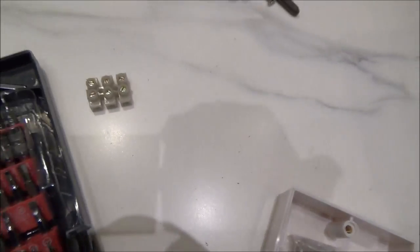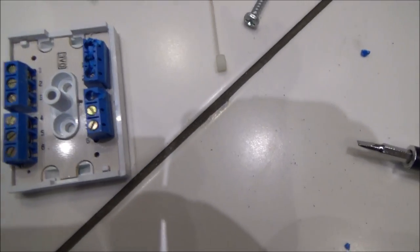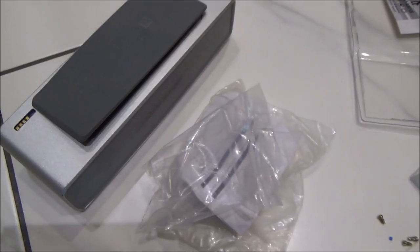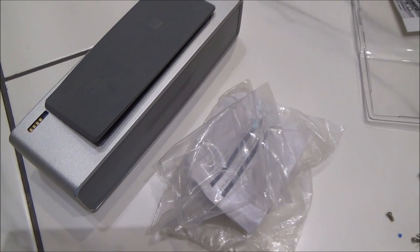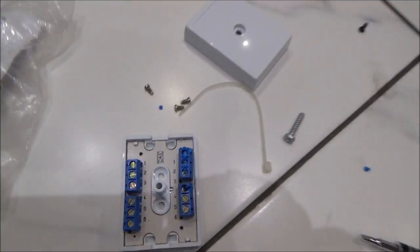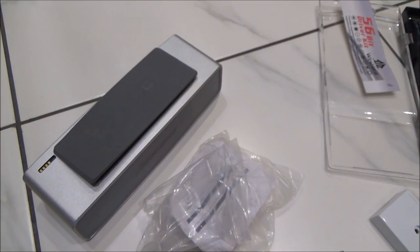The problem is, the screws for this are incredibly small. So then I thought, okay, well, what's similar to that? So then I started looking into telephone sockets, and they were still too big, but eventually I got myself a telecom block terminal socket here. I've still got loads of these left over from when I used to sell telecom products. And these screws here are just about perfect. They look to be a tiny little bit on the big side. Remember, I'm screwing into aluminium, so I suppose even though it's slightly big, they're going to kind of make their own thread on the way in. So it's not ideal. They're almost perfect, but not quite perfect. But that's them there. So let's pop them in here, and hopefully that will get rid of the vibration.